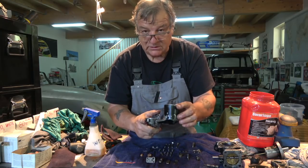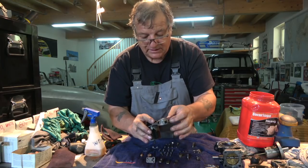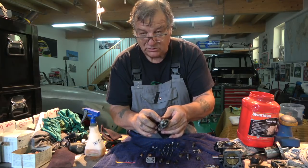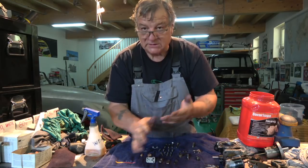And I say they're 106 pounds each. And as I say, this one snapped off. I tried to get it out with an easy out, but I've gone undersized with the drill so I can re-tap it for the new piece that goes in. So there's a couple of tips there.